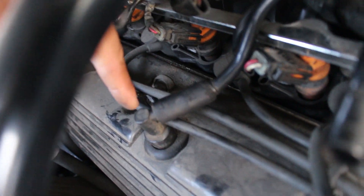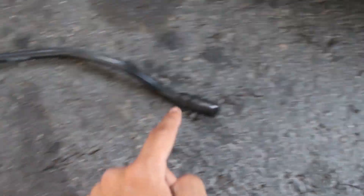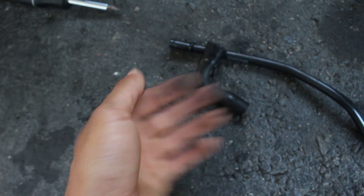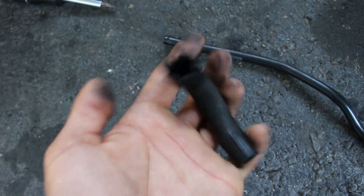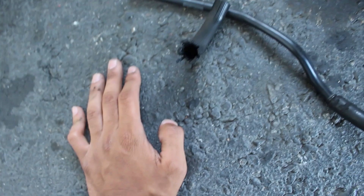You can see down there — there is my PCV valve. I'm going to go ahead and take off this tube; you can see it runs over here to the intake. I'm going to remove all that. This goes from the PCV valve to the intake. As you can see, mine is all cracked and rubbery — messed up. That's bad. So it's a good thing I'm refreshing these, and let me show you how I'm going to do this.